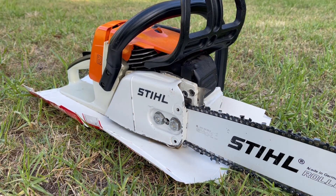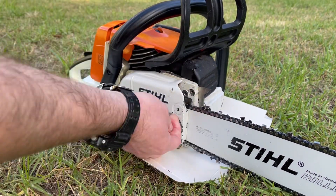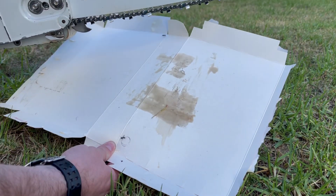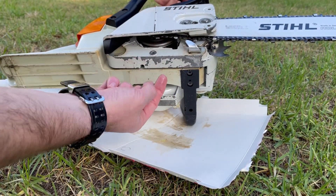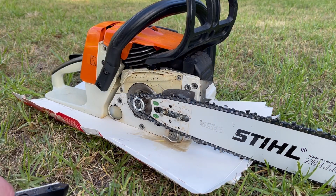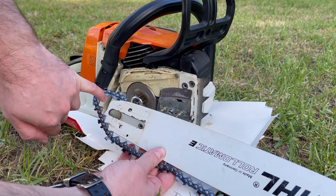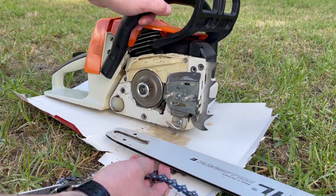I've had this saw sitting for 12 hours and this is how much oil has leaked out of it. Let me show you the oil that's come out — looking underneath we can see it's all coming out here, it's all under here. Pop the clutch cover off, pull this off, bar and chain comes off. You can see it's covered in oil here and also all around here — it's leached down the side as well. It really is everywhere.